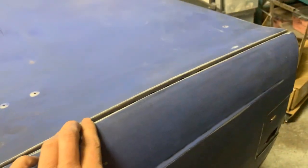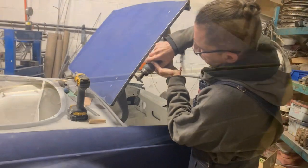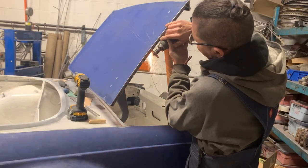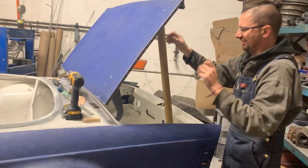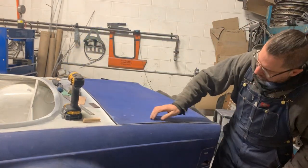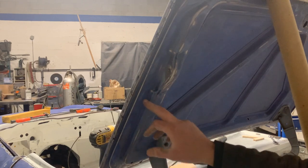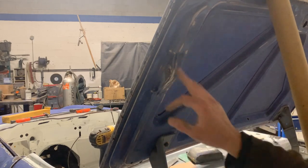Okay, so it's raised a little bit and that makes it look much better in that corner, and everywhere else except here — now this is even more raised. So I have a cure for that. We made the relief cuts but still it doesn't move because we have a lot of structure here. It's not only the flange that keeps it in this shape, but also this whole structure inside.